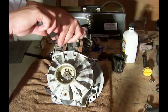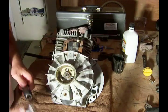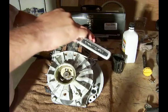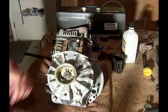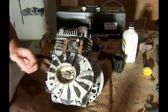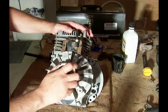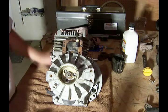You want to stop right there and then tighten up the ignition. With that tight, turn the flywheel and slide the paper out. Now the proper gap is set between the flywheel and the ignition.